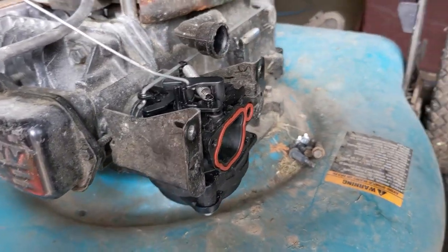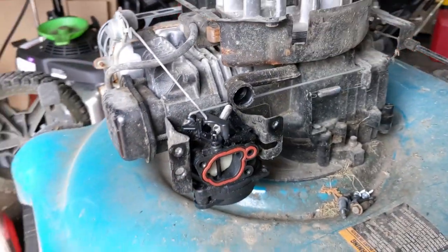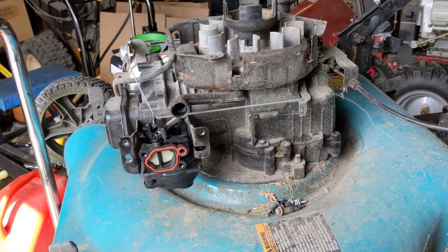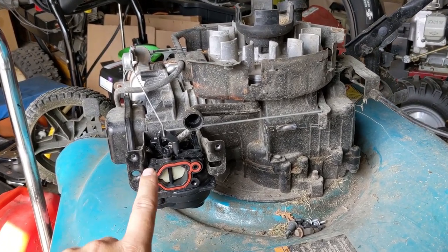So just a quick little update video showing you guys that manufacturers will go ahead and try to remedy the issue if they get enough warranty claims, because it'll end up costing them a fortune to have all these brand new mowers come back that won't start because of a design flaw. That's going to wrap up today's video — just a quick little update, because we got that mower in needing a carb clean, and when we were disassembling it we noticed they had changed the design. I was actually quite surprised to see that Briggs & Stratton chose to change the die that stamps that piece of steel instead of choosing to redesign the mold that forms the plastic choke lever.